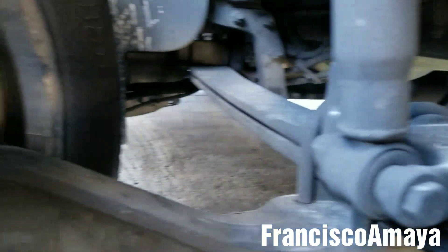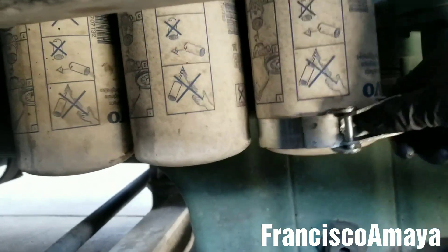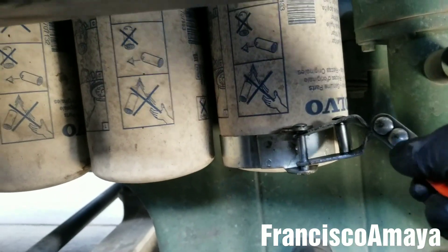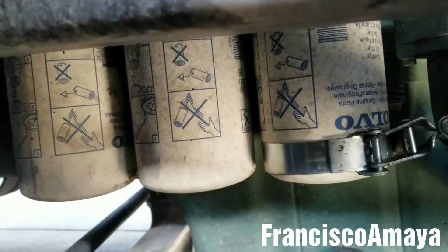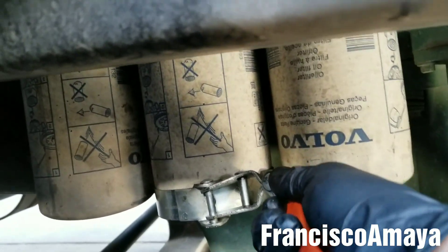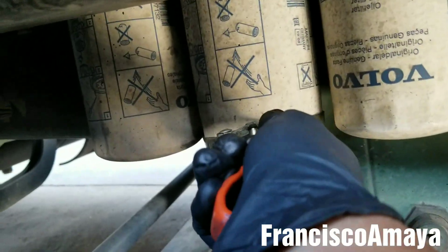In the meantime, we are going to remove the oil filters. In this case, the oil filters are located right here, right where the axle goes. There are three filters — this is the bypass filter, and we have the other two filters. These filters can be super tight to remove in some cases, depending on who did the oil change in the past. I did the oil change myself last time, so let's see how tight it is. They're pretty soft to remove, and still you have to do some effort to get them loose.